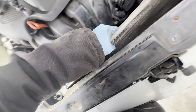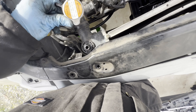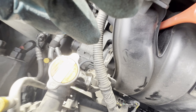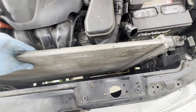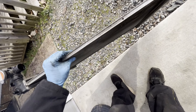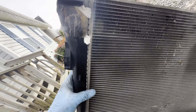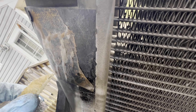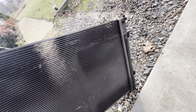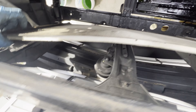Let's see if I can do it with one hand. The bottom one didn't come out at first but there we go — it's out. The radiator is coming out. From here we can investigate where the crack is. The crack is coming from somewhere up here because it's wet there — pretty sure there's a crack going there. We can also investigate the AC condenser.